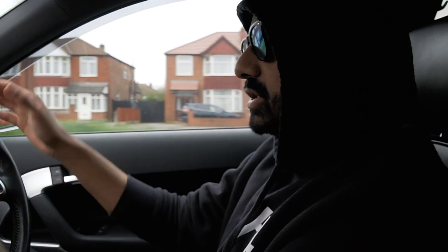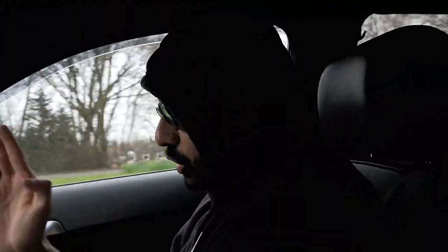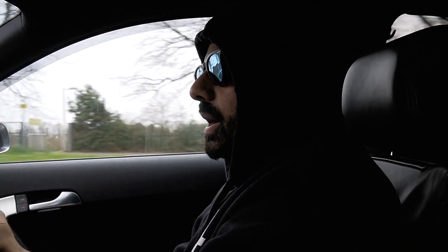Yeah, see that groove? If you don't put it on straight, then your steering wheel will be bent to one side and then you'll be like, whoa, what the fuck is this? It's because you didn't line up that groove. So take it for a test drive, then you'll have to reopen everything and make sure that groove of the steering wheel matches the one on the car, yeah? Beautiful, mate.